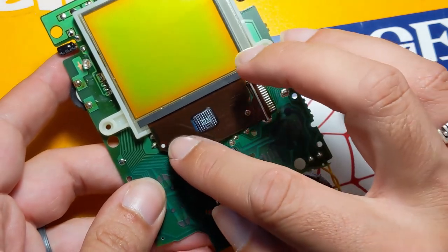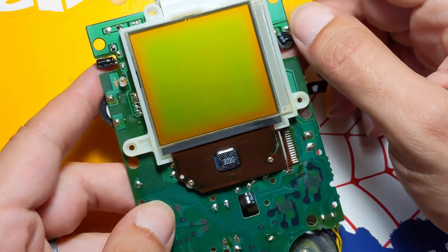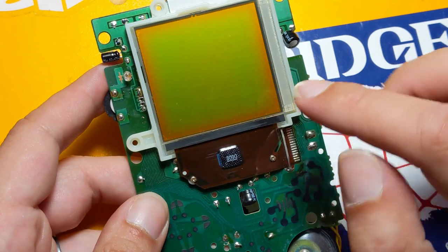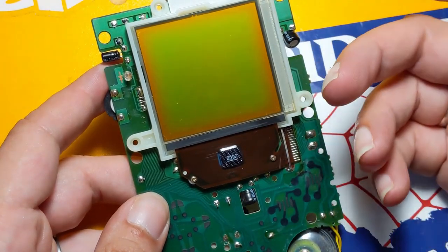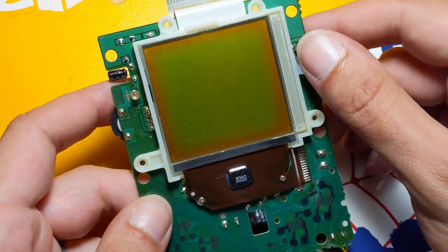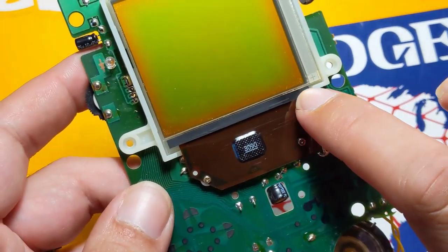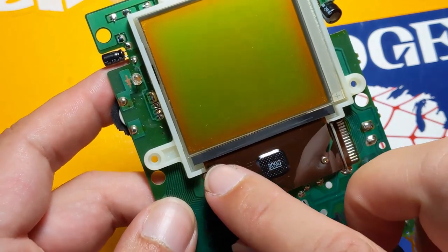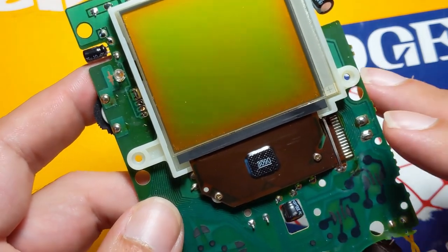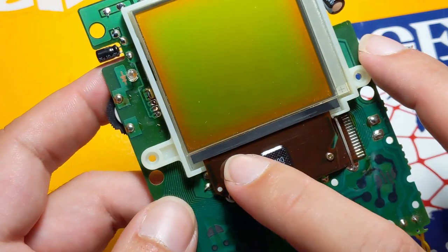I cleared some workspace so we could work on this board. The problem is basically this ribbon connection right here going to the bottom of the board — this is for all the vertical lines of resolution on the display, and as you can see, that was the problem we were having. If you have horizontal lines, that's an entirely different thing. The connector's actually under the board and it's pretty hard to get to, so that one may be a screen replacement option. But for this, what we're going to do is get rid of this rubberized strip, clean it up, and basically just introduce a soldering iron across the bottom of the strip and see if we can reflow some of the solder contacts from this ribbon down to the actual display — that's what's causing those lines.